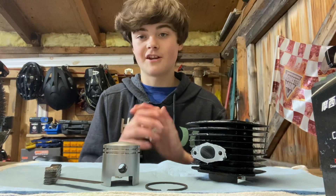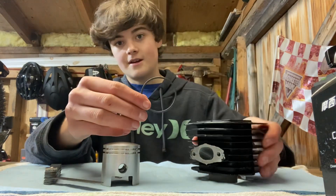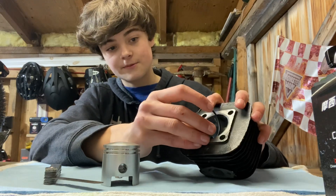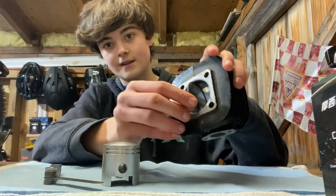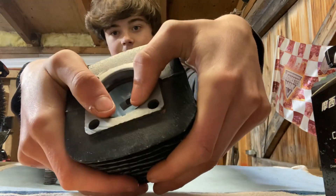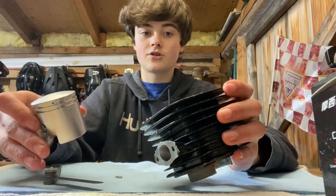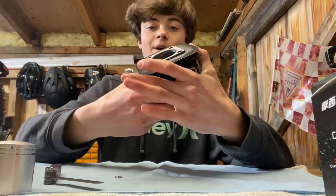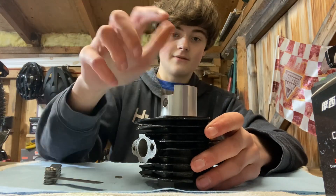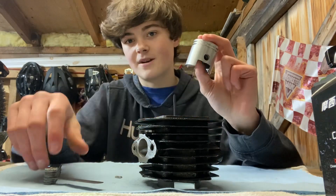Now we're actually going to measure the ring gap. Here's how to do it: take your piston ring and stick it vertically in the cylinder, push it down a little bit — you'll feel some resistance, but this gets it in perfectly. You'll notice the ring can move freely and pivot. Pivot the ring with your two thumbs and seat it into the cylinder so it's flush. To get it perfectly true with the cylinder, you'll notice it has a high spot and a low spot. Use the piston that came with your bike, insert it, and push it down a little bit. You can buy ring squaring tools, but for these motorized bicycles, this is all you need.